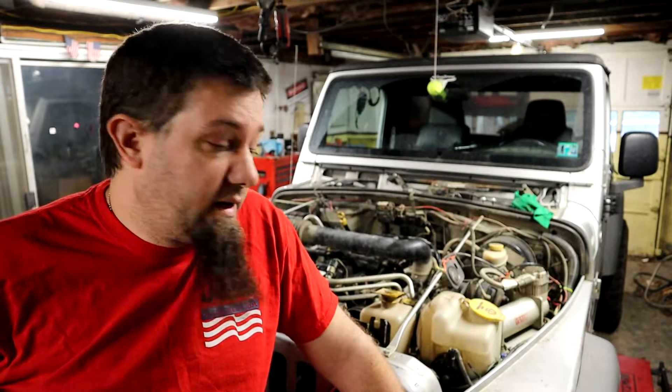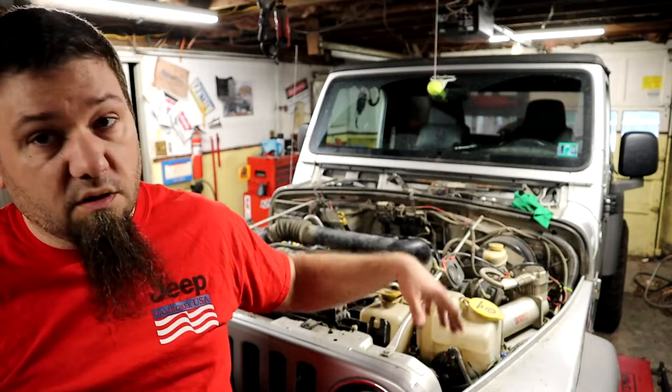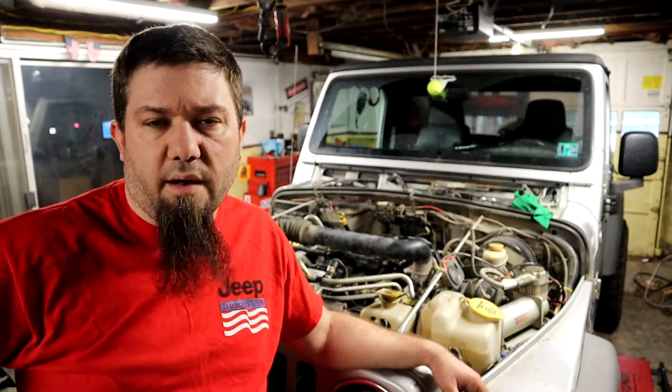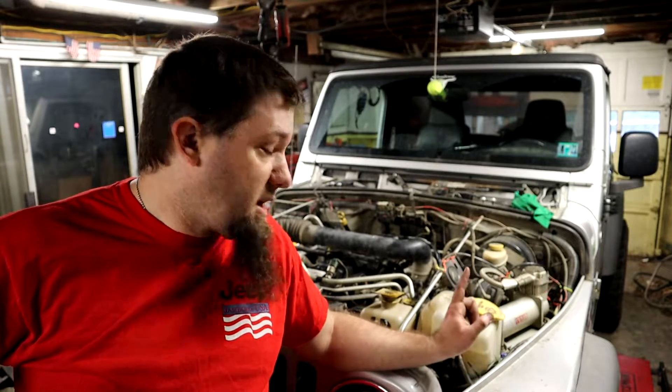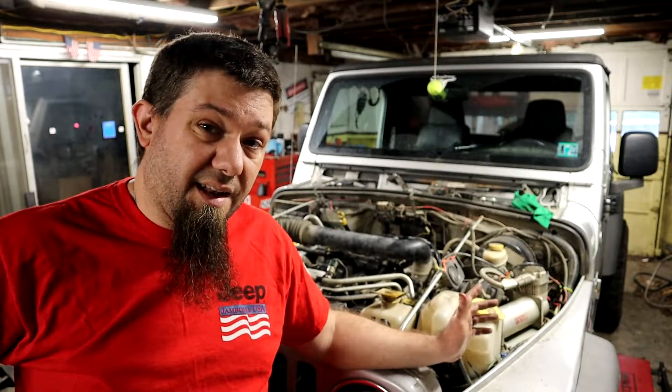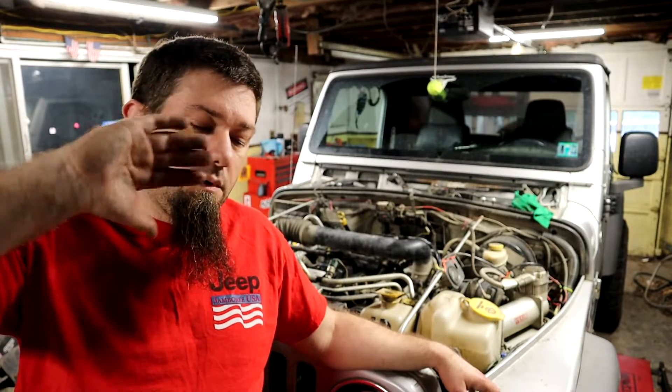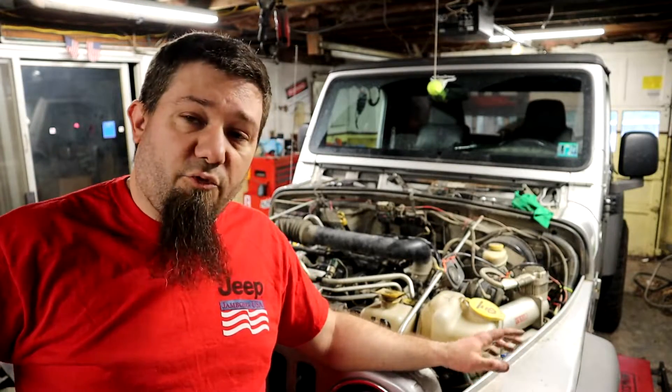The next step is trying to get this fender off. I've got the front already disconnected. I got the bolts on the back of the grill and on the front of the side of the grill already out. I took them out actually a week ago when I started figuring out this project. My goal next is to get the back end of the fender disconnected and then see if I can actually just kind of lay the whole thing down on the tire, which would be really nice, or at least push it down out of the way. Maybe leave it hung up on the spring tower. If I can get it far enough out of the way, then theoretically I can get to the bolts on the exhaust and get them loose.